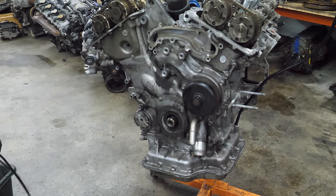Now we're going to remove the oil filter housing and the oil cooler. Personally, I don't like seeing this out of plastic — I'd much rather this be made out of aluminum. Got a couple of knock sensors to disconnect. Now we're going to turn this over — you should probably get a pan to catch all the stuff that falls out of it. The screen looks good; it's not full of debris. Now we're going to remove all the 13mm bolts that hold this upper oil pan on.